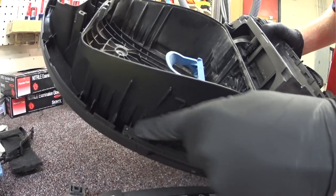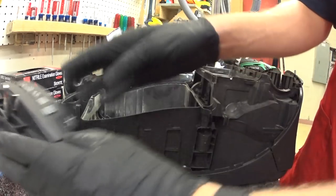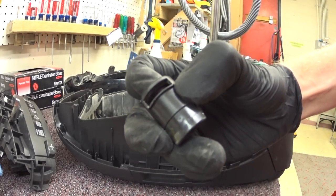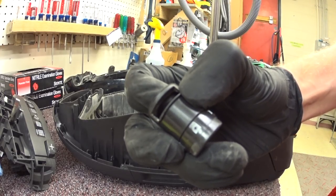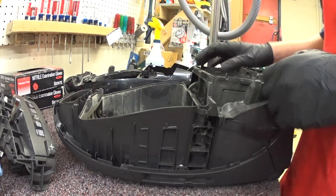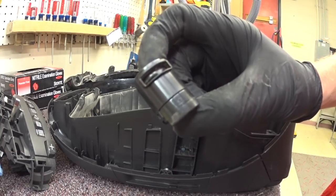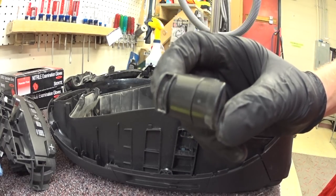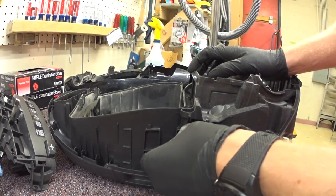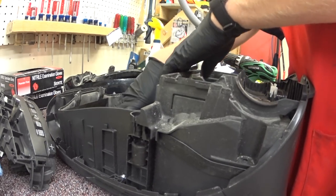You can see that there are markings for the molding, but they're not there — they've been removed. A cool thing about the S8 or C3 series canister is there is the relief valve. This also applies to an S6 that opens. Panasonic and a few other vacuums have done this, but what makes this relief valve unique to these newer Mieles is — on the 5000 series like the Capricorn and Pisces — the US market just got a blank thing here. It didn't actually get the relief valve; they engineered it out on the US market because I guess we weren't worthy of it.